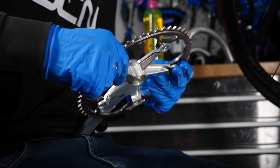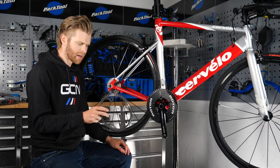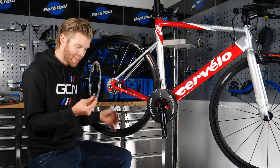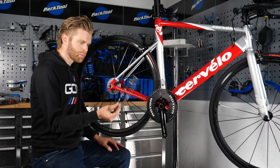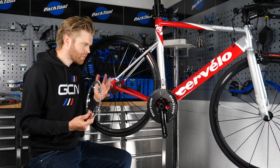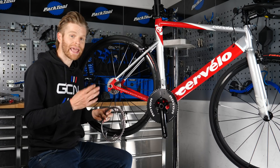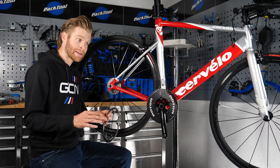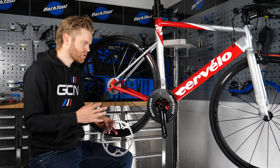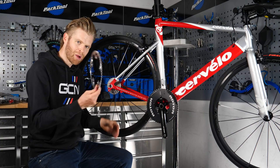The only downside is the chainring she has is a 52, which is massive for a bike like this, especially in Bath, which is really hilly. I've got a smaller 45 chainring on order, which I think will be better because gear ratios are important. I'll go into more detail in the next video on gear ratios, how to calculate them, and how they affect fixie performance — but for just setting the bike up today, I'll put this 52 on.